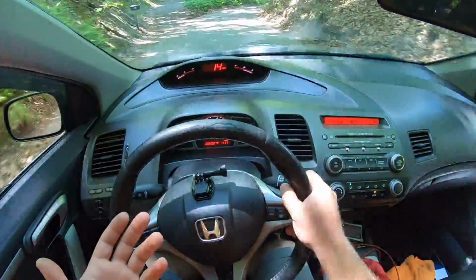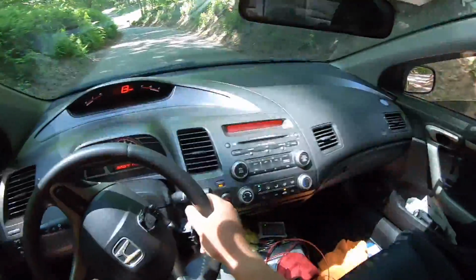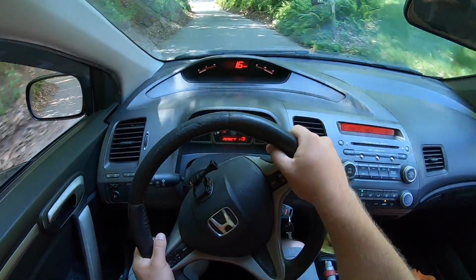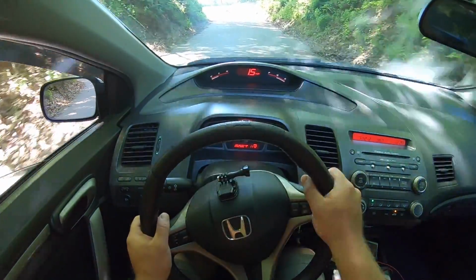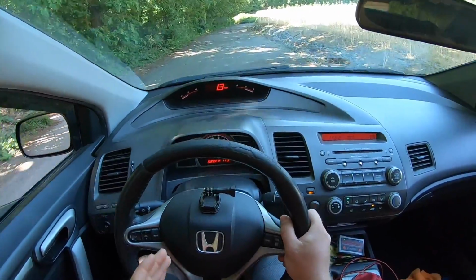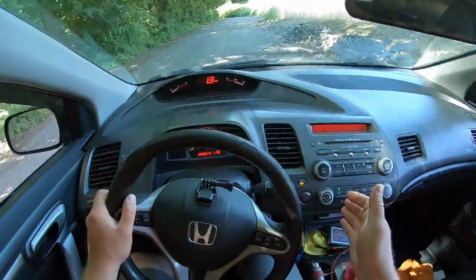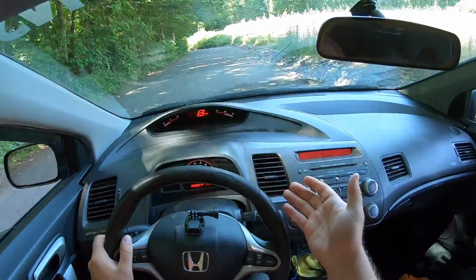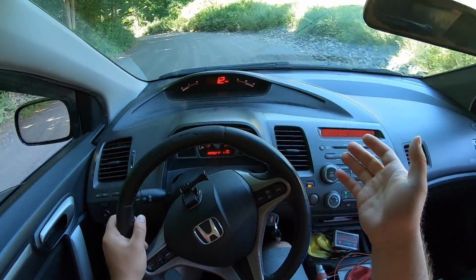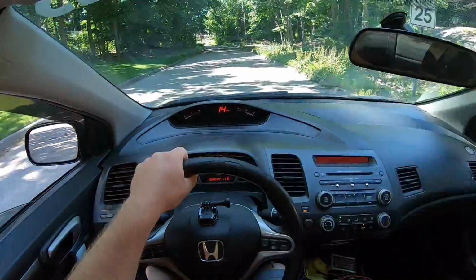Accelerating, definitely more noise, the usual you can expect from basically all solid mounts doing that. I decel, noise as well. I can't tell you how much more vibrations these will cause when you add a 75A rear mount, because like I said, I'm utilizing the OEM mount, so there might be more vibrations than I'm stating or that you guys can see from this video, because I have the full set, but I'm not running the rear. Just for starters, guys, we're gonna get right into this.